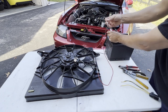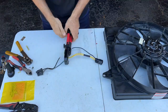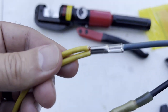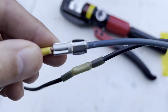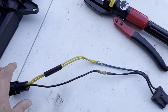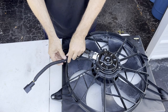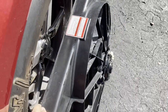Before actually wiring up the harness, always give it some power and make sure it spins the direction you expect — that'll save you an overheated engine and having to tear the harness apart and redo it. Whether you're on stage one, two, or three, you need to build this little jumper harness. It's coming together really nicely. On the ground side we used a smaller connector with heat shrink, crimped down. On the other side, because we were joining multiple wires, we had to use the medium-duty hydraulic crimping tool and get a thicker crimping piece. Got some heat shrink on here and corrugated cover, and we have a complete harness. Mach 8 on this side, factory harness on this side — we'll plug it in and zip tie it down.